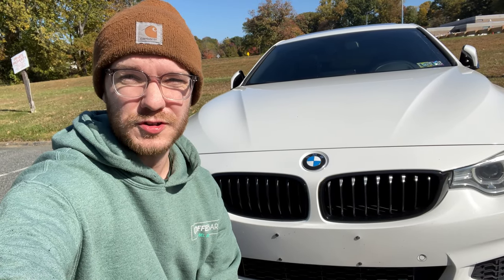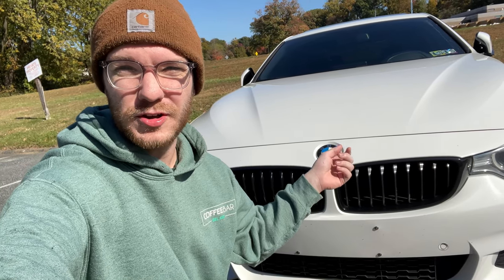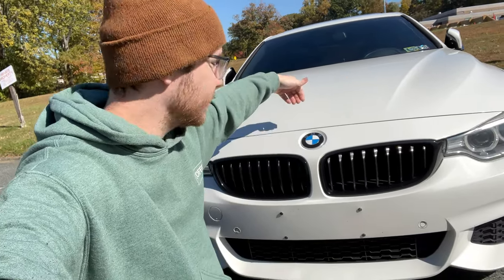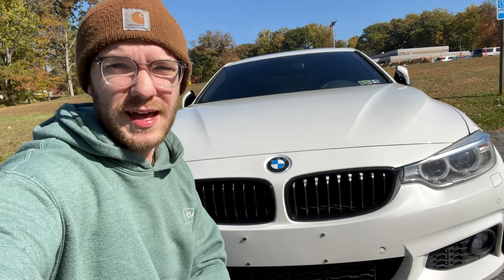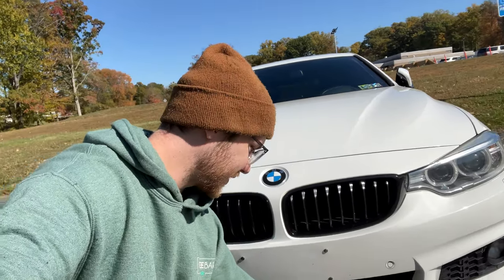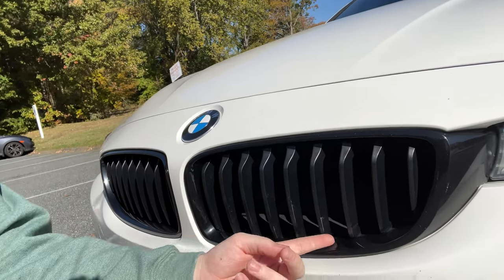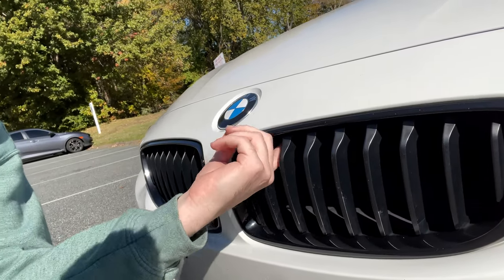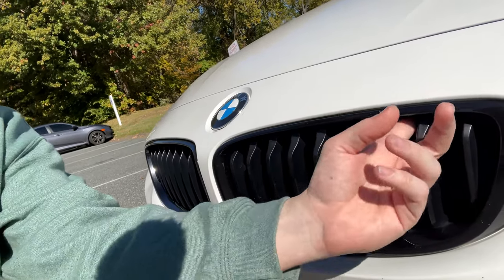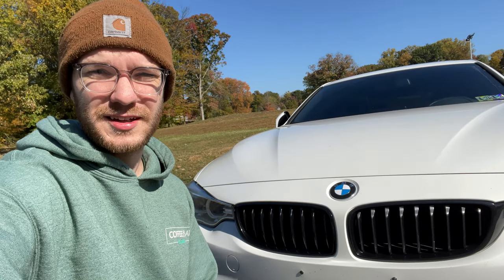There's really nothing to it — no magical science to taking these out. I know most people say you should lift the hood, take off the weather stripping, and undo the bolts that hold the bumper together so you can get underneath. But I don't do any of that. On my last BMW it wasn't necessary, so I'm not doing it this time. There are clips on the inside — I think three up top, three down below, and one on each side. You can just get your finger in there and gently bend down the clips.